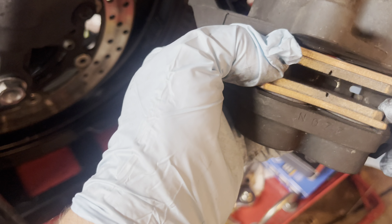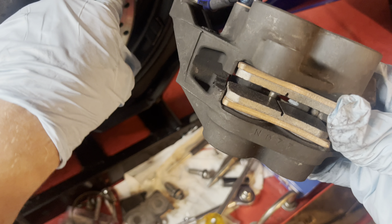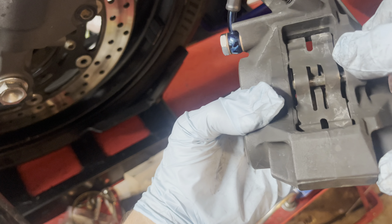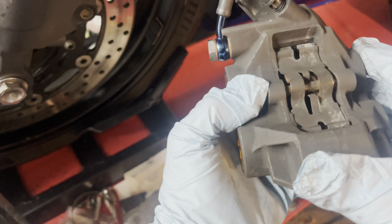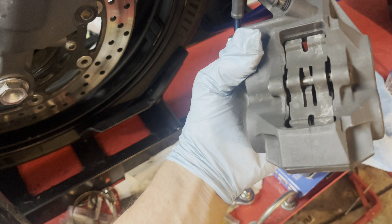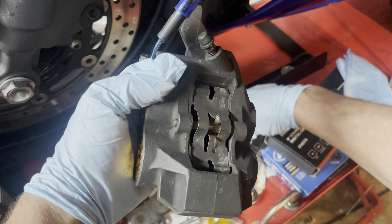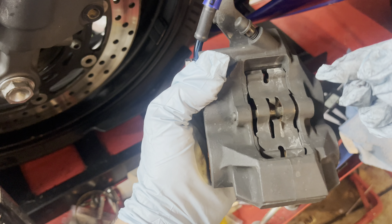Except I've got to get those cotter pins back in there. The reason why you push the pistons back is because you've got to have as much space as possible as you put the new brake pads in to let it sit on the disc. It's hard to see but there's a hole right there, and obviously there's going to be one on the other side. I'm going to push this in just a tad bit more so that I can see the other hole. I can see both holes now.